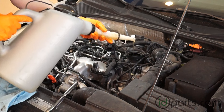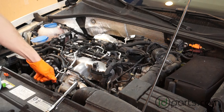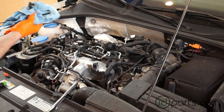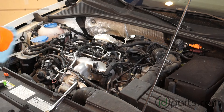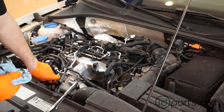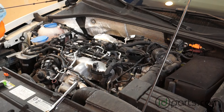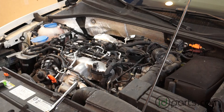After you've poured in 4.5 liters, it's time to take the initial dipstick reading. Just pull the dipstick out before you turn anything on — be sure you've got oil on the dipstick. It should be higher than the top line because you haven't turned the motor on and don't have any oil in the oil filter housing yet. If it's higher than the top line, it's a good point to start the car up.